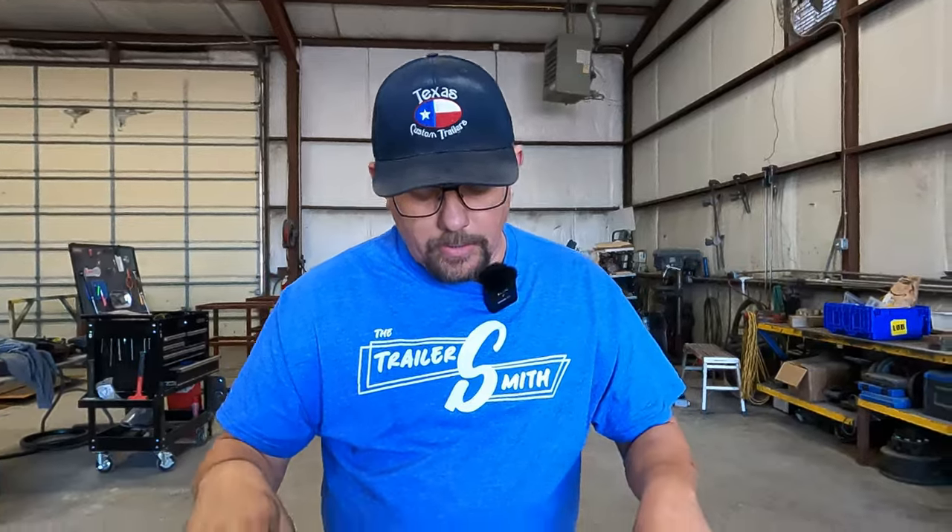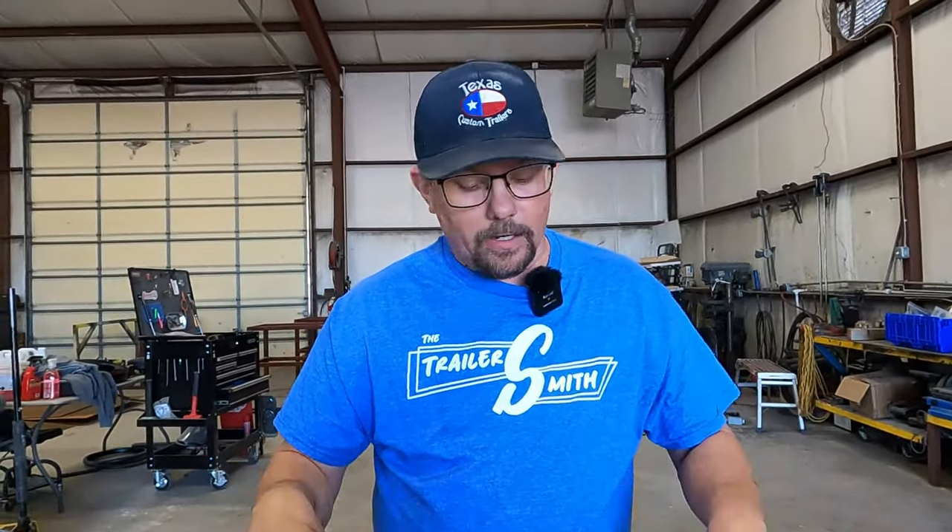So I hope that tells you when to replace the drum. Most of the time, if you're going to have to replace the drum, more than likely you're going to have to replace the brakes too. Some of these are super expensive on the big 8K stuff — 7K is not so much. As I say over and over, we see so much come in off the road from repairs not done correctly and just wear and tear. It may be expensive now, but it won't be as expensive as if it comes off and tears your trailer up or, God forbid, hurts somebody or damages somebody's property. So those are the things to look for — the very basics. Do that every time you're doing a bearing pack, anytime that drum comes off, look at it. I'll leave some links in the description below for some drums — some you can get online, some are harder to get — hopefully useful if you're in a bind.